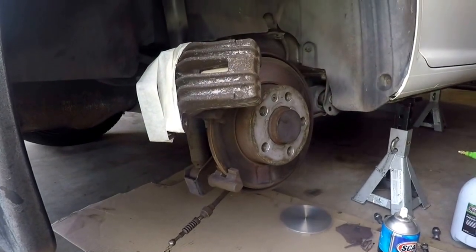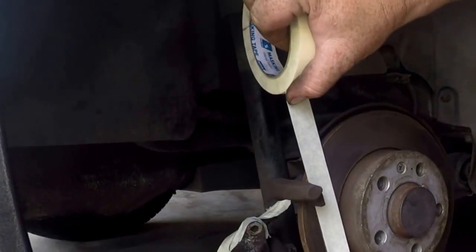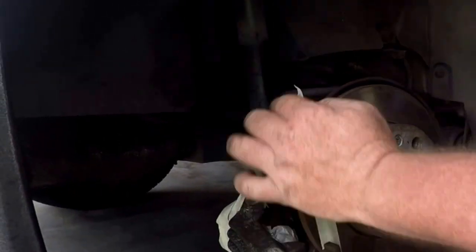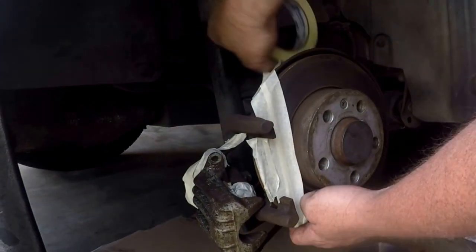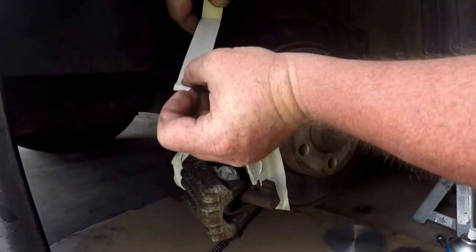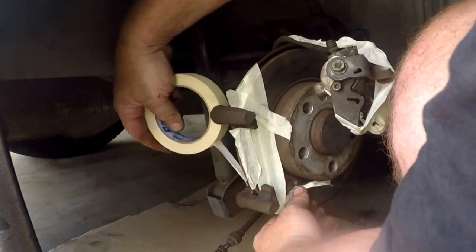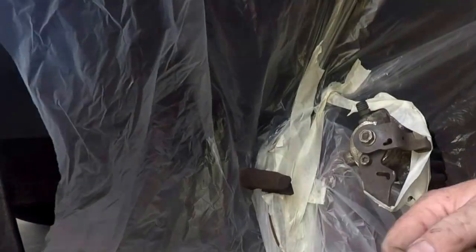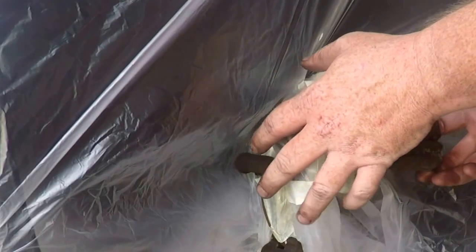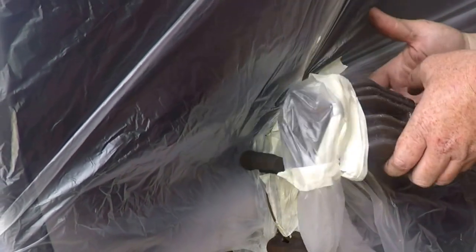After everything is cleaned and dried, it's time to start masking. I only had a couple of hours to do this job on a Saturday morning, so I masked up the extra stuff. You could fully paint all the back of the caliper, but I took a bit of a shortcut — I just painted the front part and the part you'd see through the rim. The rear part and the handbrake mechanism I didn't bother with, as you won't see it anyway when it's on the car. I've got some large pieces of plastic stretched over the wheel well just to prevent any overspraying. Remember, you're wanting to mask up anything you don't want paint on. Spend the time to get the masking done correctly and you won't have to deal with overspray later on.